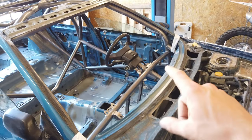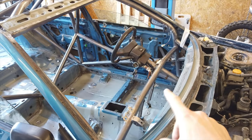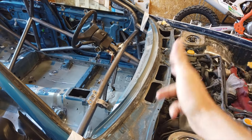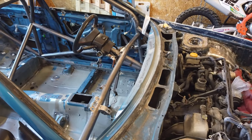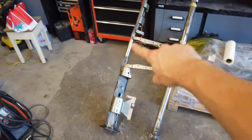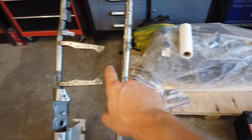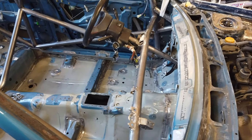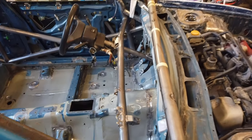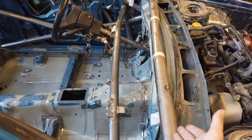When you get a new roll cage like this, you get all sorts of tubes and bars, including a new dash beam. It's all nice and fun until you realize you have to put all of the original brackets back onto this beam — everything that holds the dash, the airbags, all the accessories. Here I have the GD beam on the right and the GC beam on the left. There are a bunch of brackets already welded on the GC beam and nothing on the GD beam because I've taken them off — they're all cut off. They're already welded onto this new bar. Normally you'd weld the roll cage and dash beam together, then realize you can't put the original beam back in to transfer the brackets.